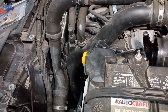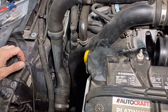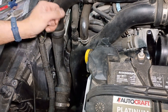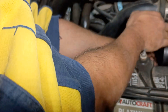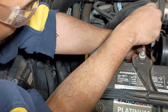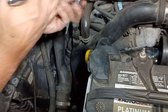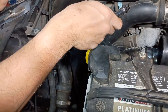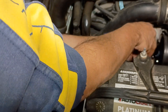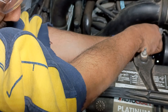I've got a wrench on there — eight millimeter. Looks like it's only two bolts. I'm not planning to catch everything in this plastic container, but anything I can get is less for me to clean up. There shouldn't be a lot of coolant coming out when this opens up, but when I pop the thermostat off, you should get a pretty good rush.